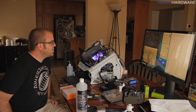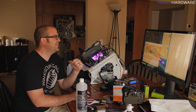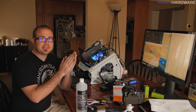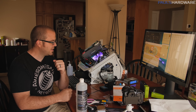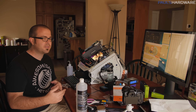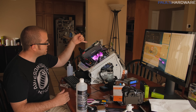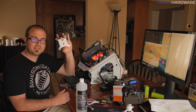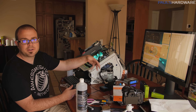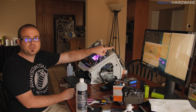We're finishing the first run with the monoblock installed right now. Survey says — oh my gosh, we just jumped 1,500 points! So let me be clear on what's been changed: the CPU has been de-lidded — though I didn't use liquid metal since I don't have any here; it should arrive tomorrow. The other changes are the monoblock instead of just the CPU block, and I increased the pump speed by connecting it to an external Zalman unit running closer to maximum speed. All of that, without changing any overclock settings, still running at 4.6 GHz on all cores, led to about a 1,500 point increase.